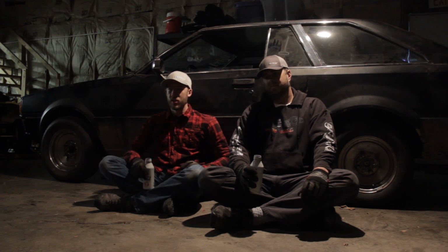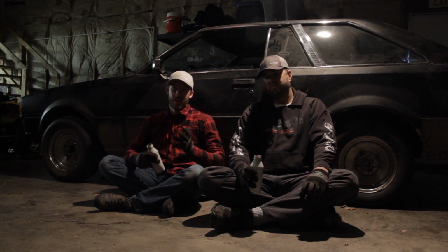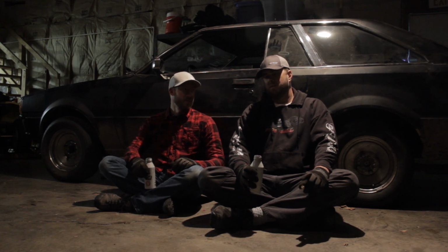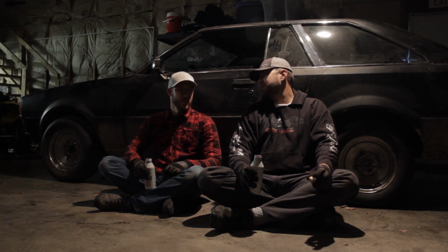No, they're not. And it turns out that the axles from this car actually would not slide into the differential housing. The splines were slightly bigger than the one we got out of the junkyard. So even two identical year Toyota rear ends must have come out of two different factories and didn't fit. Same splines as far as spline count. Exactly. Different spline diameter. Yeah, just wouldn't fit. So we went from a spare axle to no spare axles.